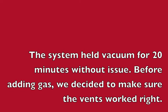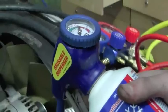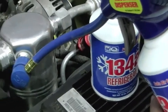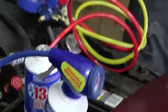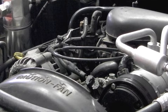Make sure you don't forget: there's a light connector hanging down that goes to the aux 12-volt stuff, and there's a black connector that goes to the one electrical actuator for the HVAC — behind the vacuum one there. You can get to it if you have long fingers, but otherwise it's kind of a bitch. Get that before you put the dashboard back on. Getting stuff out of the floor, which is new. There's definitely stuff coming out of the floor. Now the big one — defrost. I don't hear any snapping noises.